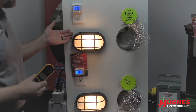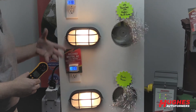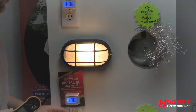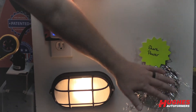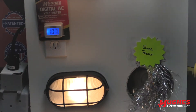That faster air speed is going to allow your AC to actually push the cold air through your RV. It's going to allow the thermostat to reach temperature and your AC unit to actually kick off so you feel the effects of your cold airflow. If you don't have an autoformer and you're getting 107 to 108 volts, the air is barely pushing out — you're probably not going to have the airflow throughout your coach that you'd really want or need with your air conditioning running.